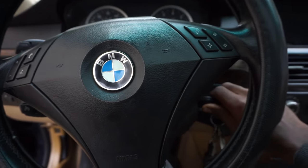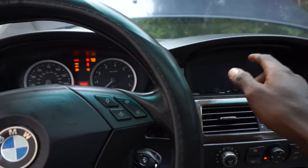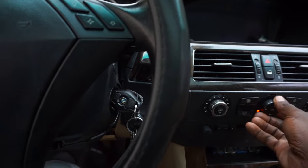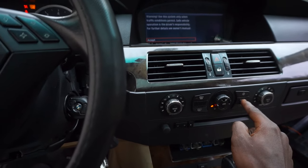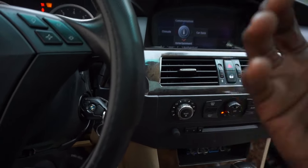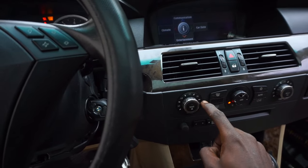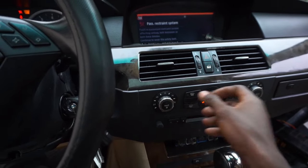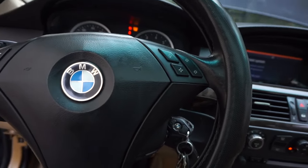Here's what you do: put the key in the ignition — that's step one — and put it in the accessory position, two clicks, where all the lights come on, your iDrive system comes on, and your AC comes on. Then put the fan speed on the lowest setting, make sure the AC and auto are turned off, so only the fan is on at the lowest setting to open up the heater core. Now put your temperature on the hottest setting — on mine the highest is 82 — crank it all the way up. This is going to open up that heater valve.